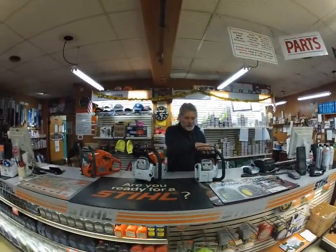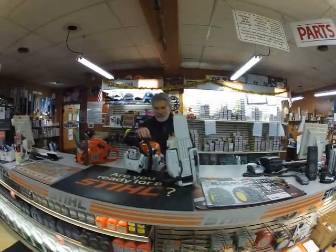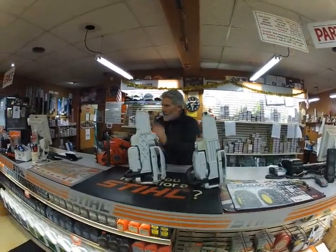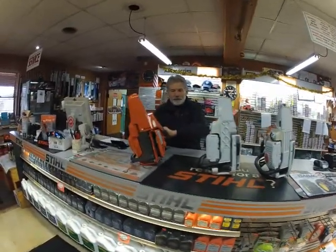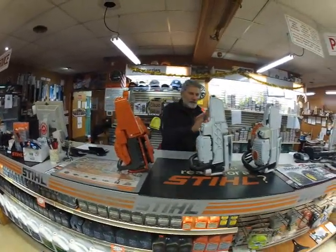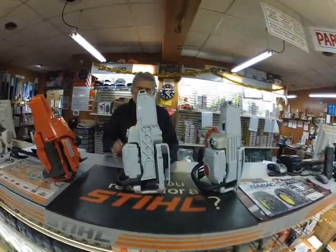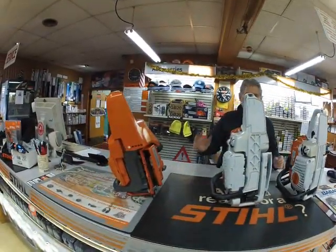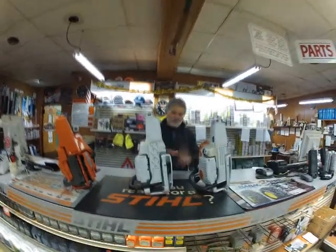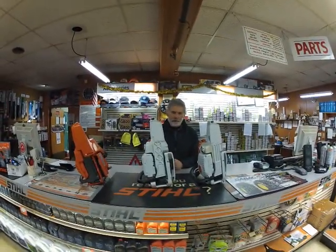And when I say modular, what I mean is these saws are basically made of plastic. The housings are plastic, and then the motors are built in a different part of the factory and then screwed into the chainsaws. You can see the plastic designs on the bottom. Is it as strong and robust as a split crankcase design? No, it can't be. Will it work for the weekend warrior, the farmer, the rancher, somebody cutting firewood? Yes, and it works fairly well.